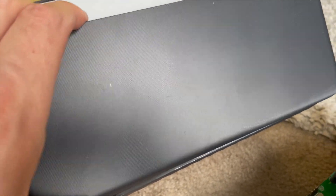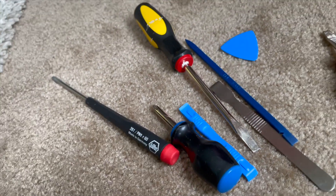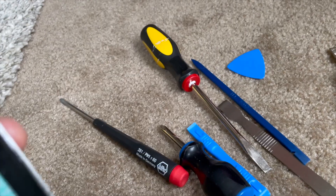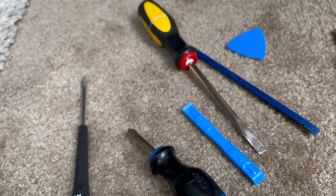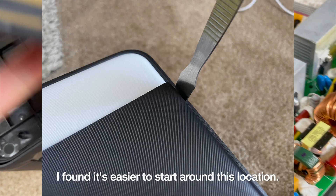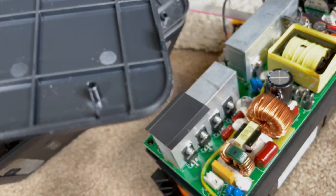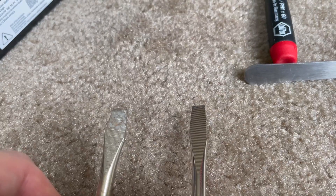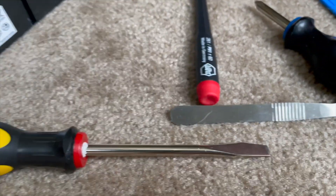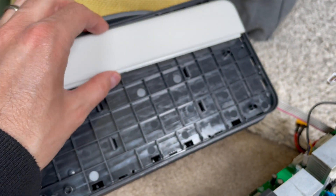You want to pry between the decorative outer plate and the inner plate, and it's not easy — you have to be patient. I used a bunch of different pry tools and even broke a spudger, cracking the tip off. I ended up using another tool that also bent a little, but it was enough to pop the plate up. On the back you can see there are a lot of clips — five on the bottom, five on the top, and two on each side. Eventually the whole thing came off and I slid in wide flat-blade screwdrivers to keep it popped open.